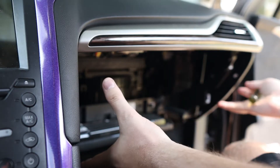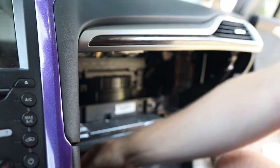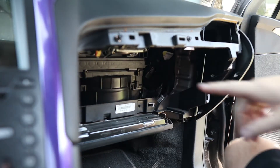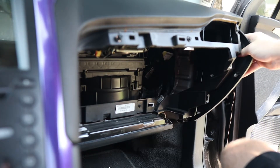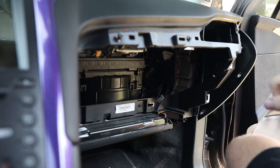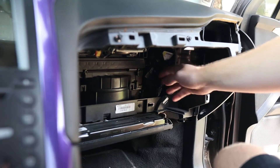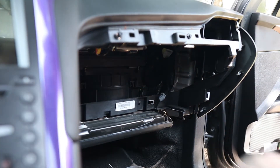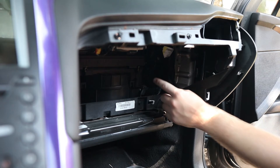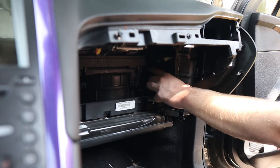Starting out, you have to remove the glove box. You have four seven-millimeter bolts or screws — one here, here, and then there's two of them hidden up here. In order to access these you have to grab this panel and pull it off. There's two more here and you might need to remove this clip on the side to pull this little panel off — it just pulls off. Then your glove box will be able to be pulled straight out. You'll also have to unplug this little connector. In the back there's a big black connector that's part of the harness that runs all the way up through the A pillar and over to the mirror. We have to replace this with a new harness for a car that came with Lane Keep Assist.